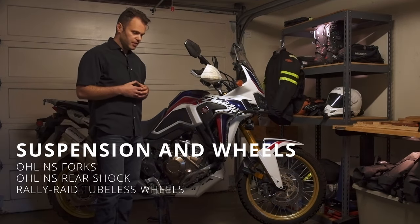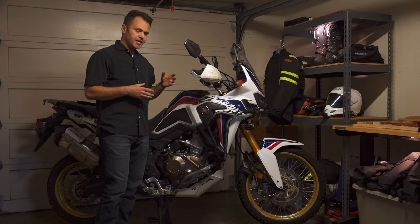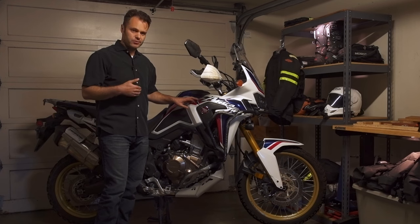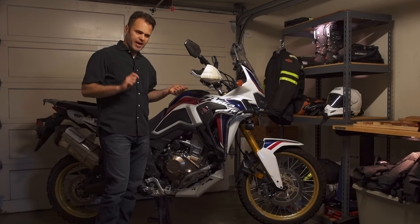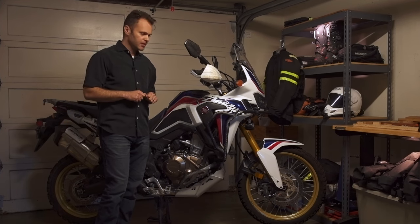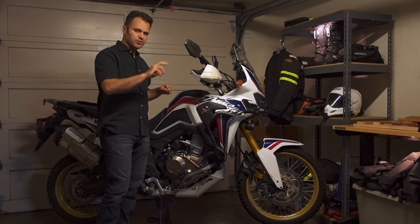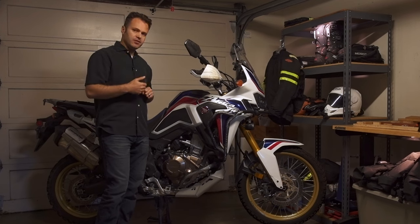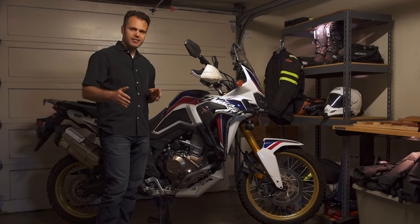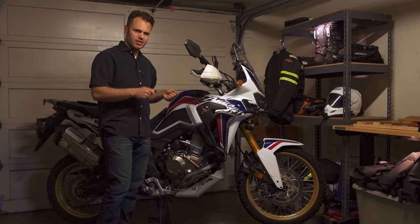Next, let's talk about suspension. From a performance perspective, the suspension on this bike is definitely the weakest link. Like most big adventure bikes, the Africa Twin comes undersprung. I weigh 180 pounds, 200 pounds in full gear, and before I put any luggage on the bike whatsoever I would already max out the preload and still couldn't get the sag set properly. On the front in particular this manifested as two things: first, it would dive — just pulling up to a red light, as soon as I touched that front brake it would just dive and the forks would collapse. And when I'd go ride twisties, the handling and turning precision was really poor because of this mushy, really soft suspension.